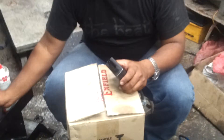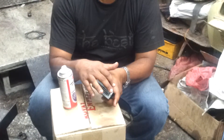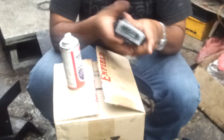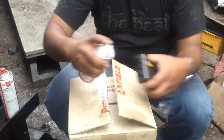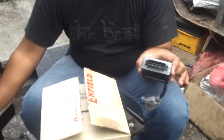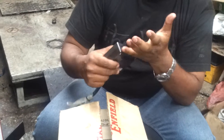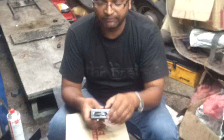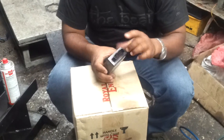Now we are going to use lacquer coat on the connector since it is clean. I am not going to use a cloth to remove whatever residue is left inside — leave it as it is, nothing is going to harm. This is the lacquer coat — shake it again and spray just a very little quantity on the connector. You don't need to spray a lot. Let it dry so it will cover all the pins properly. Since this is a video I'm doing it a bit fast, but generally I keep it for a longer period for drying.